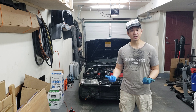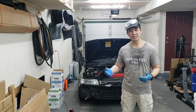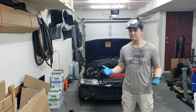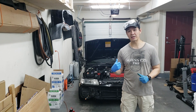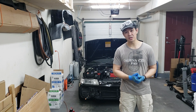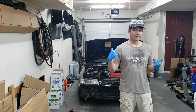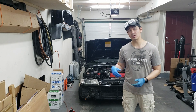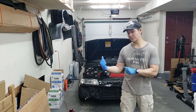I have no clue what's rattling and the noise is not noticeable inside the car at all. It's likely the compressor, but I can't replace it — I don't want to drain the refrigerant to warranty it at RockAuto, and they probably won't send a replacement anyways since this was the last Matsushita unit they had. I'm not really sure if it's normal or not, but it's a bit too much work to take it all apart. It wasn't making noise at the beginning when I started charging but then started rattling. I'm wondering if it's overcharged, but adding two full cans is what the specification calls for — the system is fully charged and we're good.